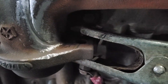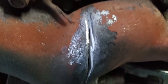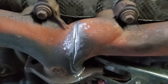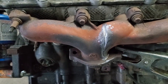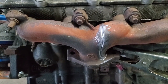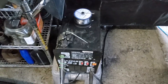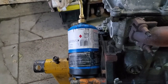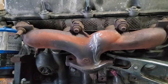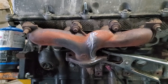It's kind of a nasty crack. We'll lay some wire into it, see if it heals itself, see if we can get this thing welded up. My small wire feed — we'll give it a shot. Crank it up all the way to high. Got this propane torch to preheat this manifold, lay a weld on it, and take a small video after it's done.